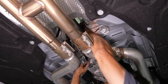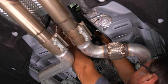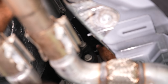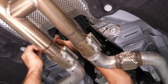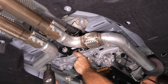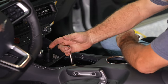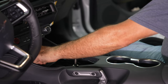Double check everything is working properly and now you're ready to get it back in the car. It may help to remove the transmission crossmember completely at this point. Get both the arm and the linkage connected, as well as the two bolts that hold the shifter base bushing into place. Re-install the crossmember and don't forget the exhaust clamps too. Then up top, grease up the shifter for the lockout collar.